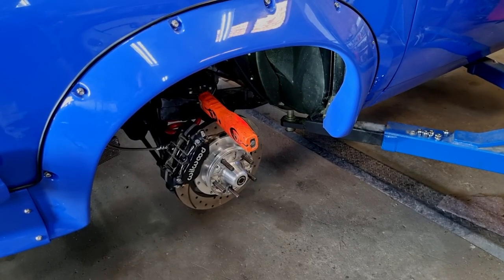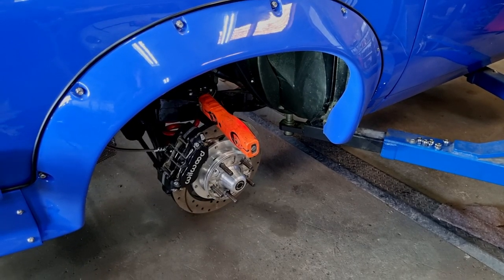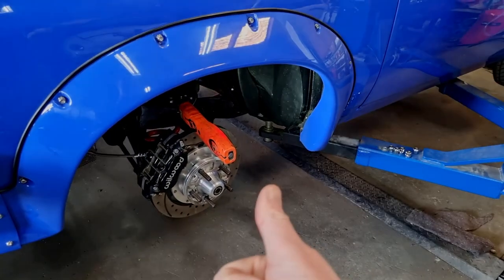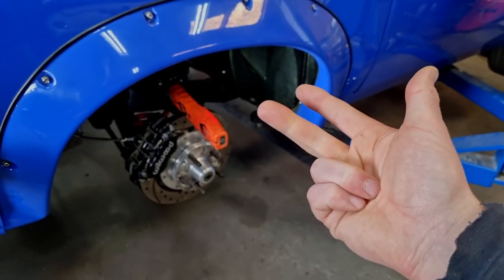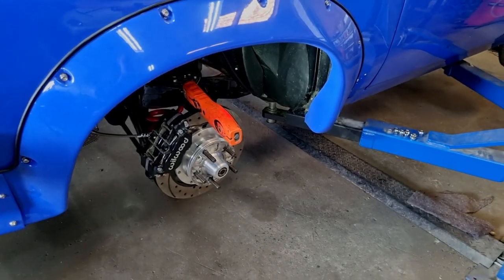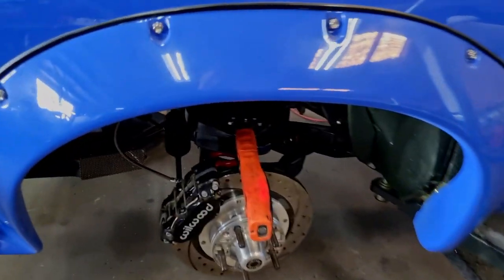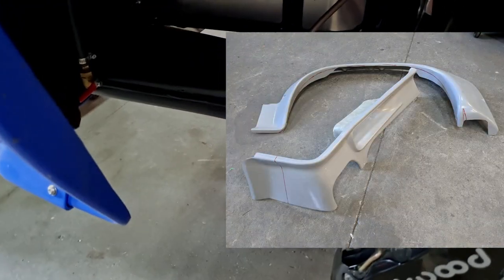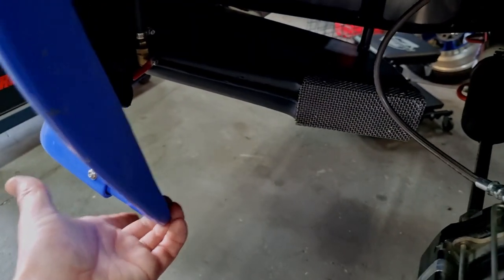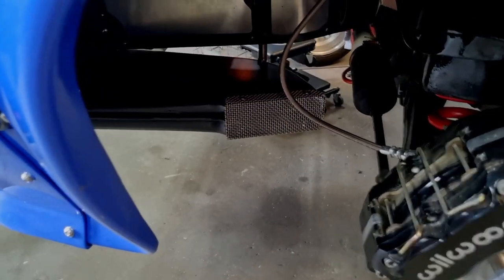I've got the wheel off the car, the suspension is just hanging at full droop. This is the front left corner and we're going to talk about the modifications to the guard of the car, the body work around the footwell, and also the flare itself. The flare is an aftermarket fiberglass one. The main thing I've done to modify the flare is cut out a bit of the thickness at the front section — it was a little bit fat. I've kind of distorted it a little bit, and the way I've bolted it on I've tried to keep it further from the car.